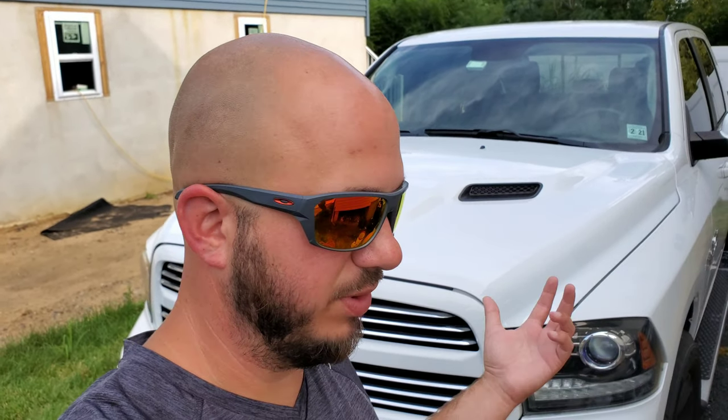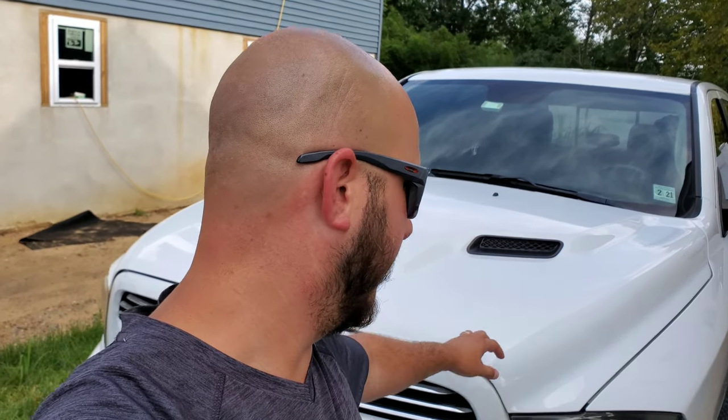It's personal preference and up to you whether or not you think you need an iron remover. I personally do use one. After the iron remover, you're still going to want to go back and clay bar the car, but at least now it's going to be a little easier and quicker because a lot of that contamination is already out of the way. I personally think using an iron remover and a clay bar is better than just using a clay bar alone. But iron removers aren't cheap, so this video isn't to convince you that you need one — it's just to show you the benefits if you've never tried it before and you're curious.